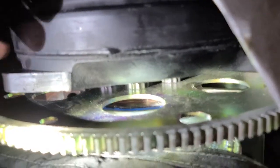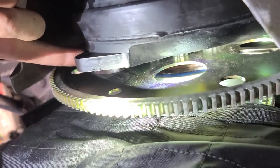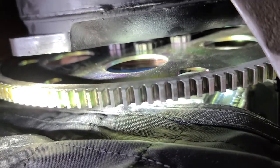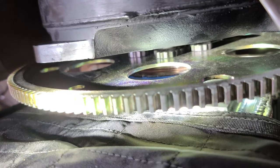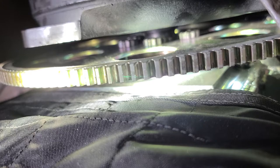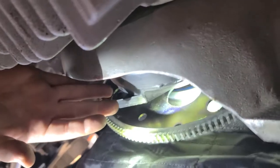There are a couple of things up in here you should be really cognizant of. Number one, if you look past the flywheel bolts, you'll see a snout — and the snout goes into the back of the crank. According to at least three different converter companies I talked to, that has to go 80 to 100 thousandths into the back of your crankshaft. What that does is align the converter and the crankshaft centerline, so when the crank is spinning at 7000 RPM, the flex plate is spinning at 7000 RPM, and this is spinning at 7000 RPM — you do not want an out-of-balance situation.